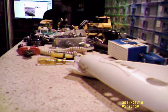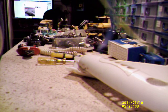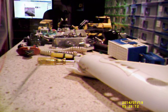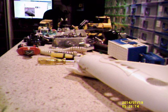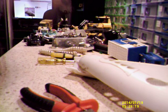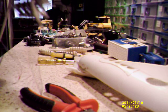That's ground. Right, and that's the earth. Okay, that's better. I can see what I'm doing there. Oh, I see. Alright, I've got it now. So one of the red wires goes to the neon light, so that is actually neutral. So that black wire is definitely the neutral from the motor. That connects to the neutral on the mains power cable, which is here.